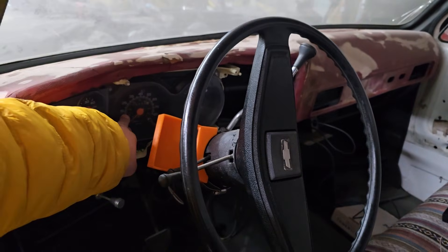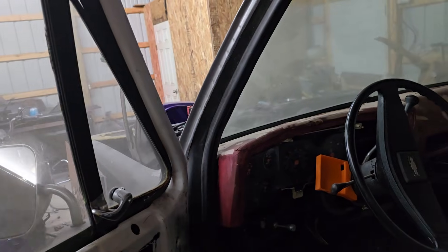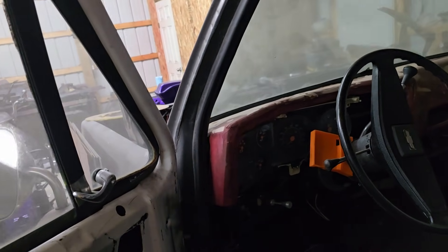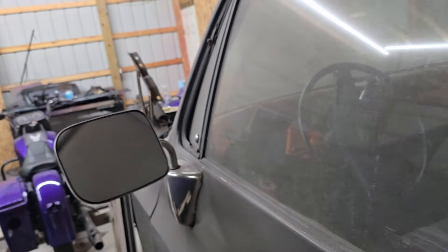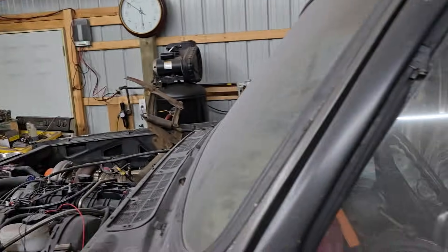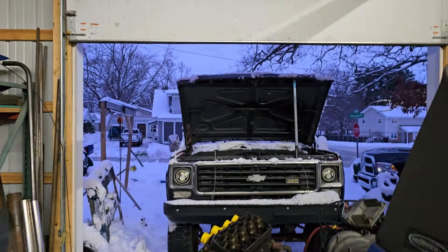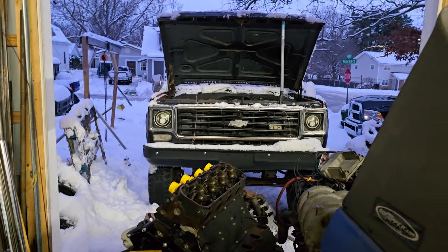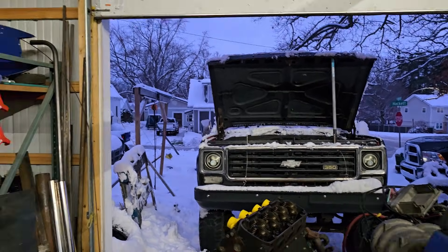That only leaves one thing: your speedometer. In your tune, if you have an electronic speedometer, it's very easy — you tell it how many pulses per mile you need. With this '91 cluster, it already works from the 4L80; it's literally what it was designed for. My speedometer would work because it has a Turbo 400 with a gear, and I'd just put that 5.3 right in front of that Turbo 400 and still have a speedometer. No problems.